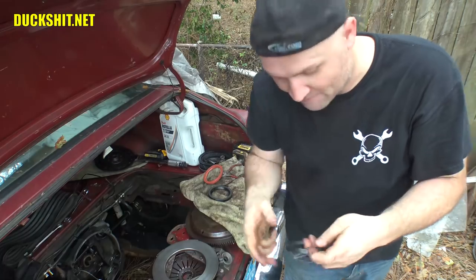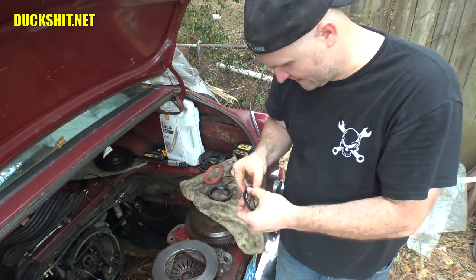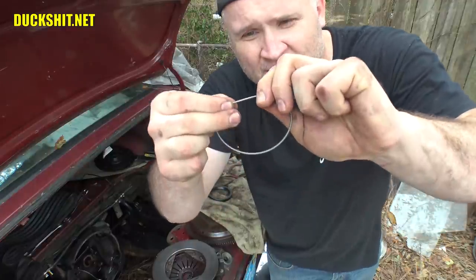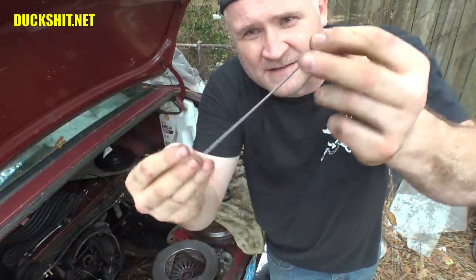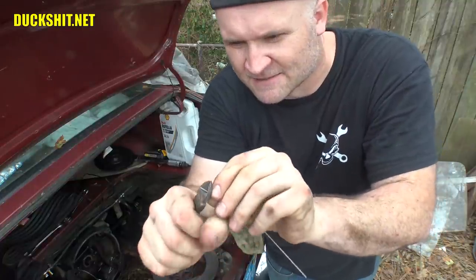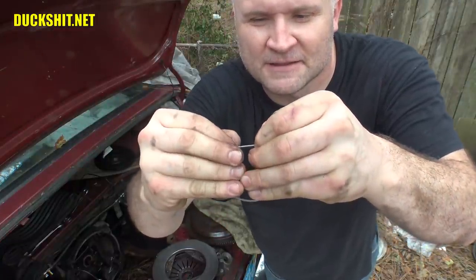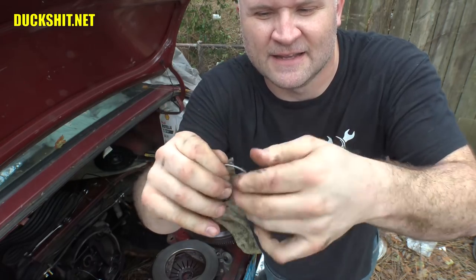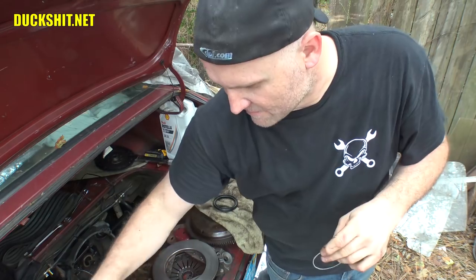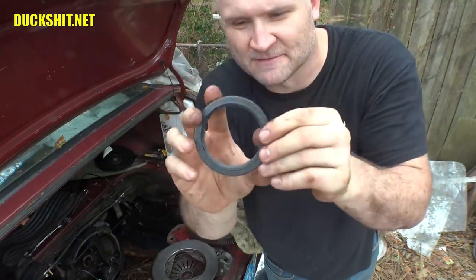I don't even know where these seals came from — probably came to me in one of my garage purchases where I cleared out somebody's shop. But this little tip here comes to me from VW Jawbreaker. If you're not subscribed to Gary over at VW Jawbreaker, you should be. You can find the gap in the spring and separate it just like so, then cut off a little section. With that cut off, you thread it back together. What that does is it shortens up the spring a little bit, and it will keep a slightly tighter tension on the inside of the seal against the flywheel, so it will hold it together better.